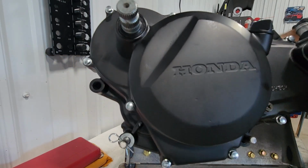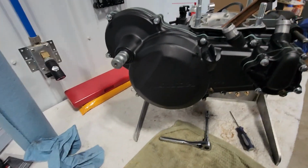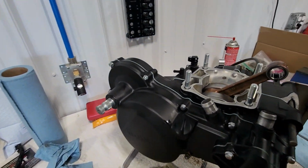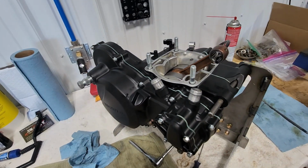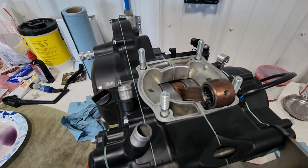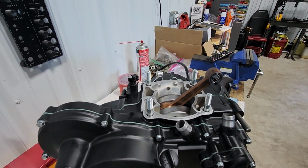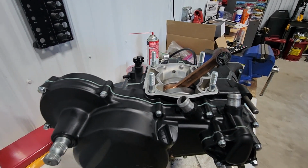Stand this up. Well, let me pull the camera back. And that is it. The bottom end of our motor is complete. Clutch is installed. All new gaskets, bearings, seals, clutch basket, clutch, stator, crankshaft. All we're ready for now is to put the top end on. That will be the next video, putting our piston and our jug and the cylinder head on. So that's it for this video.